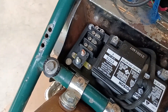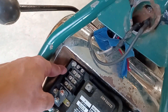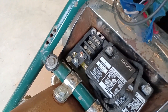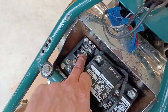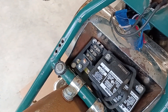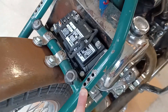On the side on the lid you can see that terminal block — it's metal-to-metal, so it allows me to hook the wire up to one side and split it out on each side. Here is the circuit breaker right next to it. The positive terminal on the battery comes into the circuit breaker and then out to the terminal block. The wires then dive down through these clever little holes I put in the lid into the inner side of the cavity of that 3D printed tray for the fuses.